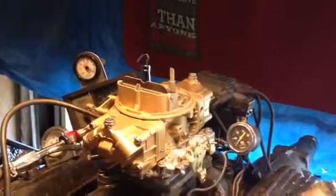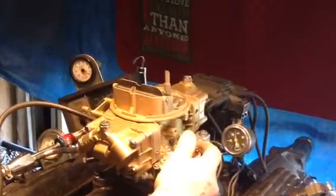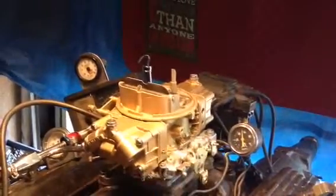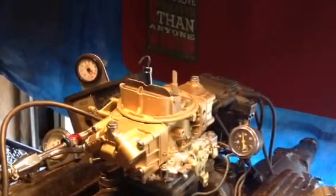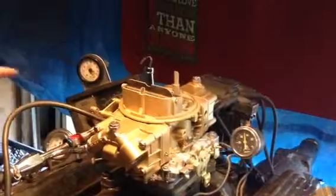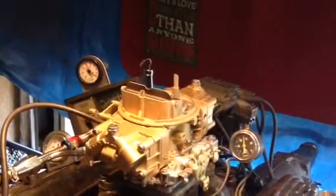We're going to go back and we're going to drop it into a forward gear with our brake back there, our mechanized brake, which is a modified transmission. Then we're going to put it under a full load and see if it has about a 300 RPM drop. If it does, the test is complete.